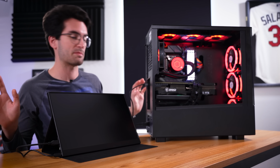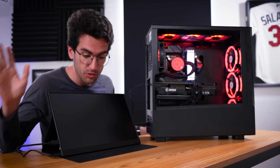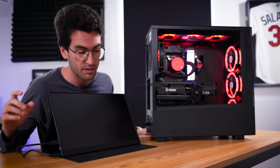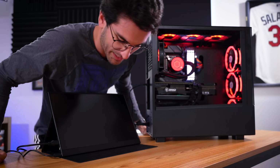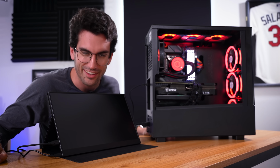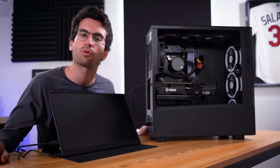Look, folks, sometimes clearing the CMOS works wonders. It's why I always do it. It probably, again, won't work here, but it's just worth checking. Yeah, we're back to the white VGA light. So, power off, and it's time to swap cards.